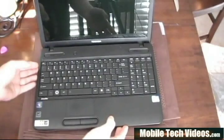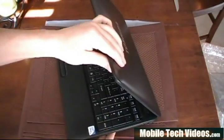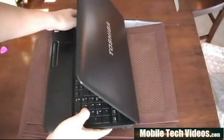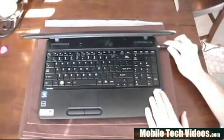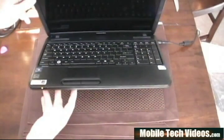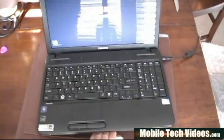At this point, before we really pop this down and snap it on, as you probably experienced it's kind of annoying trying to get those cables connected. So before we go any further we want to test and make sure they are. Go ahead and reinstall the battery as we've done — this will also serve as your LCD test. We're going to plug our power in as this battery is fully dead. That's one good sign — we see our power light down here. We want to tilt the screen back and turn on the machine to test our touchpad and everything.